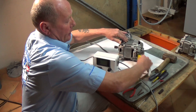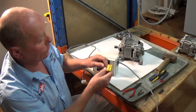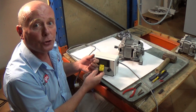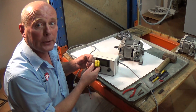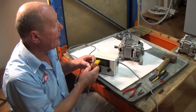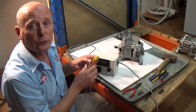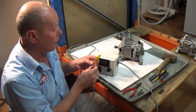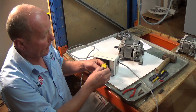Now disconnect the electrical block. This motor is a six-pin motor. Two of the pins are used for the tachometer, which sends the RPM of the motor to the circuit board so it can understand what RPM the machine is doing. On a wash cycle it might only require 60-70 revolutions per minute; on a spin cycle it may require 800 RPM; and on final spin a 1200 RPM machine will build up gradually to its maximum speed. The tachometer handles that. Then we have two wires to the windings and two wires to the brushes.